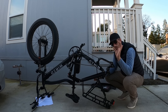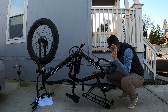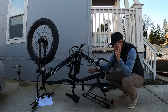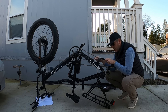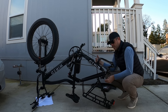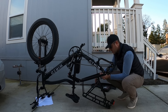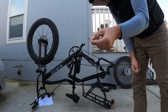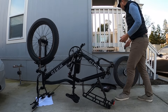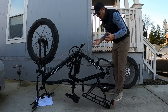I just noticed there's a small washer on the underside of the rack, but there was not one on the other side on the fork. So there were bolts going through with washers into the fender, and then on the underside there was one here on the rack in between the rack and the fender. I would replace this washer with a rubber one — that would probably prevent a lot of this vibration if you intend to keep your fenders on your bike.